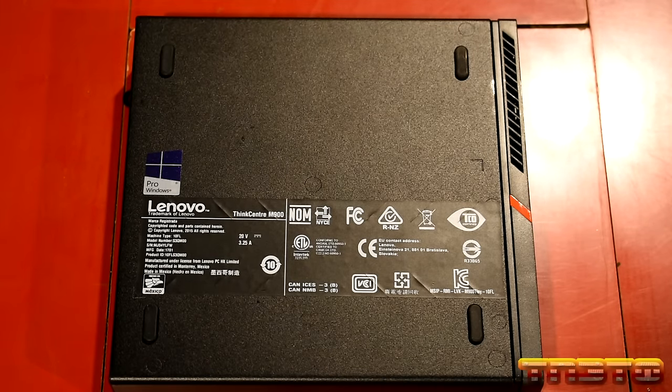We'll go down to USB hard drive where it says Sabrent. That is my Ventoy drive. We're going to select UEFI and hit enter. This will boot Ventoy in UEFI mode. Secure boot disabled. Awesome. So we are now in Ventoy, okay? And you'll notice down here, it says UEFI. So we are indeed booted with UEFI, which is good.